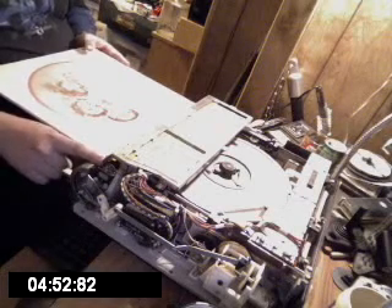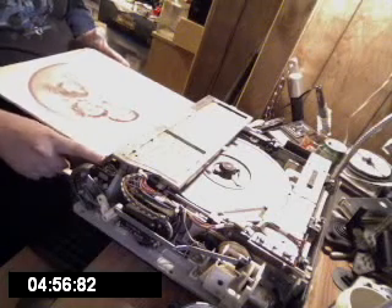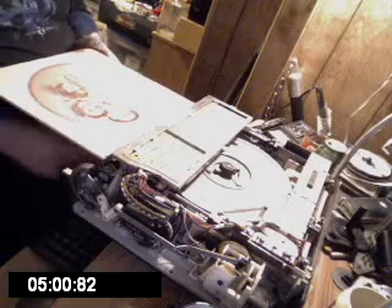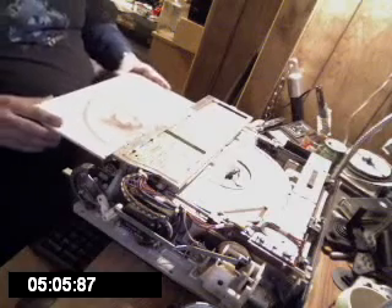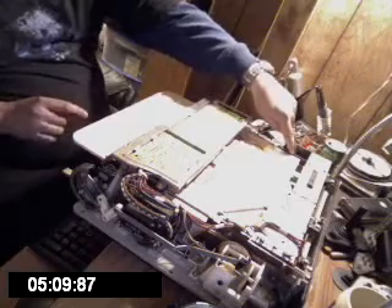If you're doing it with the top off, don't just jam the thing in there. There is a groove in the plastic on each side here, just above the plastic lip that moves up and down to cover the slot. That makes it so the disc slides in nice and level, and it's also got it on the back on the side here.